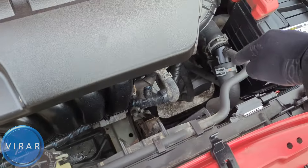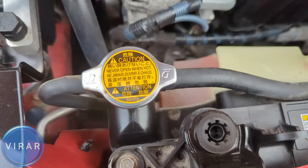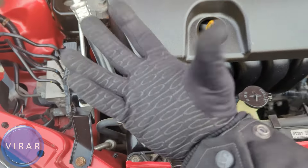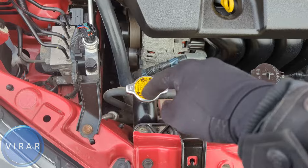That right there is your radiator pressure cap. One hose leads to the main radiator hose over there, and there's a label right there on it — it says 'never open when hot.' You don't have to open this anyways, but especially don't ever open it when it's hot, because there's pressurized hot coolant underneath there that's just going to spray out and cause serious injuries or even death.